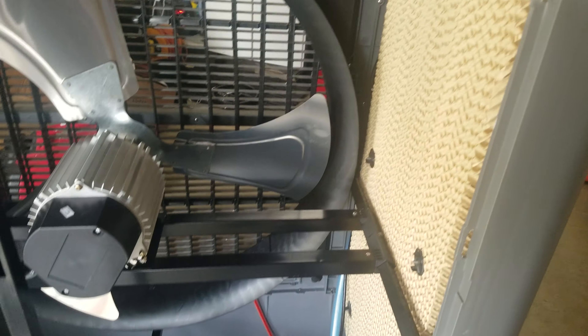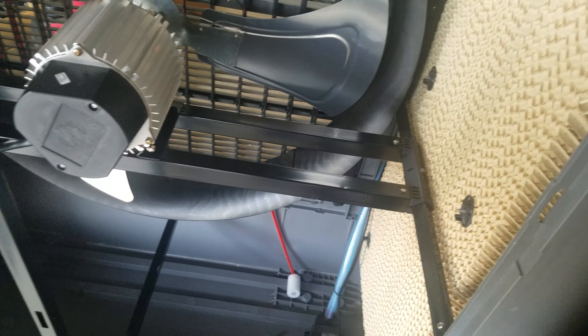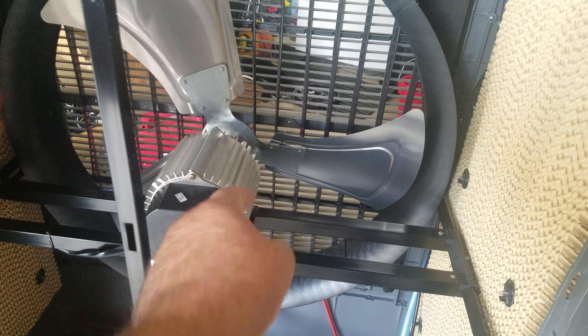Water sits in there, and when this filter gets closed and we turn on the controls, one of the controls will turn the pump on. That pump pumps the water — it's like a waterfall. It falls and these get nice and wet and cool, and it sucks air into this cold water. That's what makes it cold — this cold waterfall in here. And then it's going to blow out cold air out of there.